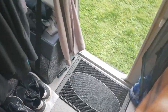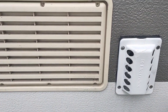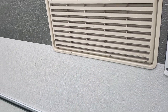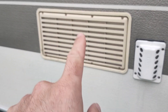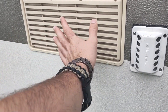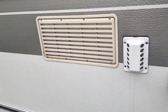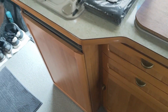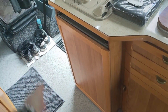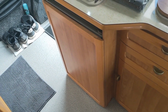There's one more thing that's really important. You have the chimney here and the back of the fridge — nothing behind it, just the fridge and all the pipes. If it gets too hot outside — like a couple of weeks ago we had 35 degrees in Germany — the fridge can't really cool down anymore. What most people do is take this panel out and put a fan behind it with a thermostat. If it gets hot, the fan turns on and blows out the warm air, so the fridge cools down again. You should do this if you travel to countries like Spain, Italy, or Portugal — otherwise you're gonna have warm beer in your fridge, and warm wine for the ladies.